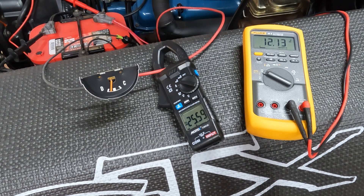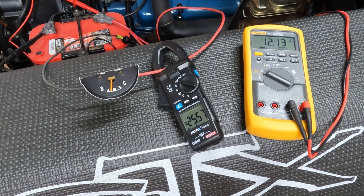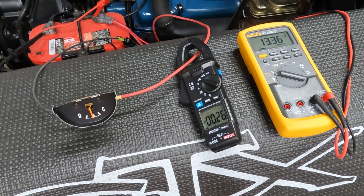These lights are pulling their current on the alternator side of the ammeter. Let's start up the car. I do have the idle on the Sniper cranked up a little bit just so we keep out of the low output charging range at the alternator.